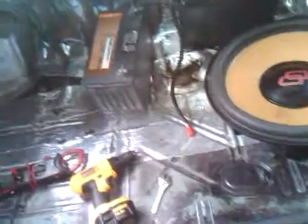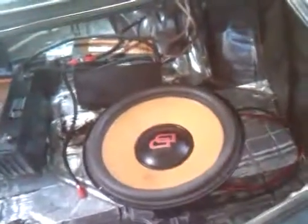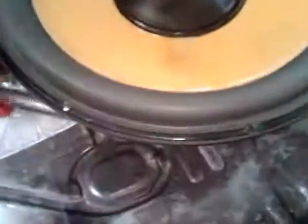I don't even have the stuff in there because I was playing it today and I noticed that when I played a certain song it wasn't as loud. So I opened the box and was listening to it and noticed it sounded kind of funny. The box broke at the bottom and separated at the top and bottom where the skinniest parts were, and the sub had started unscrewing itself from the box and was leaking air at the bottom. So it was blowing air through the port and through the bottom of the sub, so it wasn't at its potential.